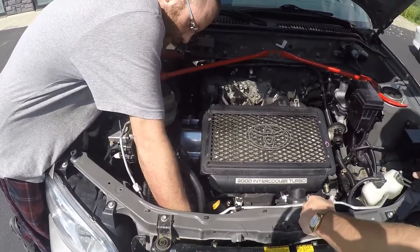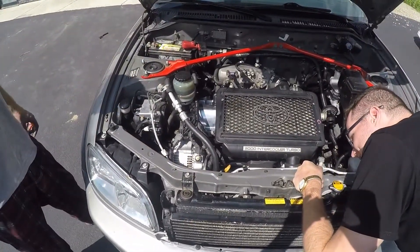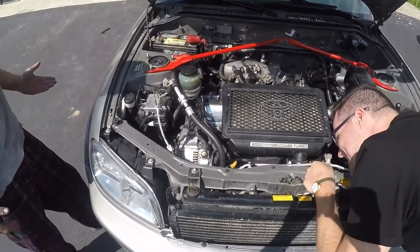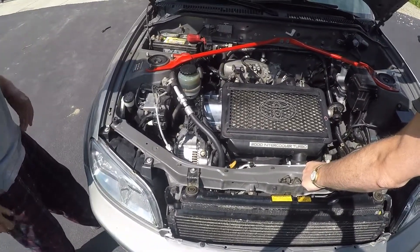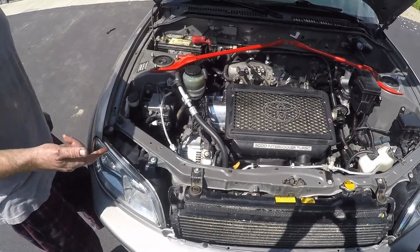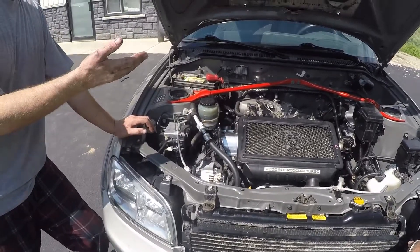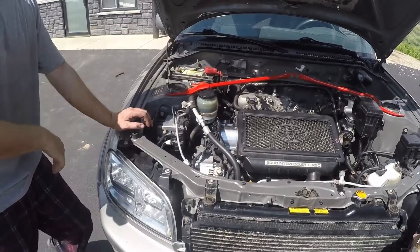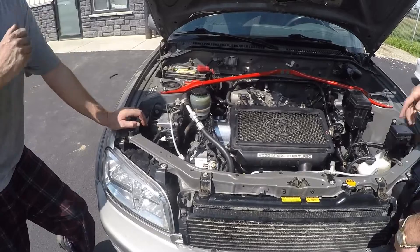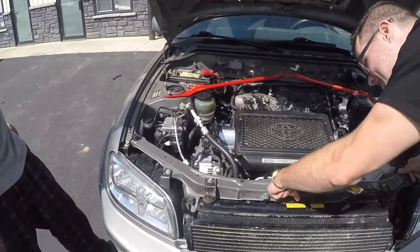It mounts to the thermostat housing, but here — this is the line for the air conditioning. It comes off the air conditioner right underneath there. I put a block of wood on there and hit it with a hammer about four times, expecting each time that it was going to break and leak the AC system. But luckily, grinding away part of the thermostat cap on the belt sander, beating that line with a piece of wood and a hammer, and grinding away a big chunk of the actual air conditioning compressor so it would fit into the Caldina AC bracket — which we actually cut a chunk off of — in order for this AC compressor to mount to the block exactly the way it mounts on the RAV4: straight to the block, no adjustment brackets, three bolts. And it worked. I was so happy.